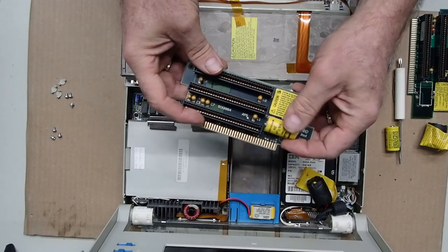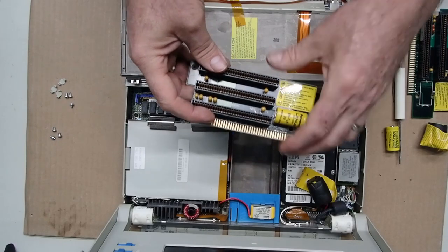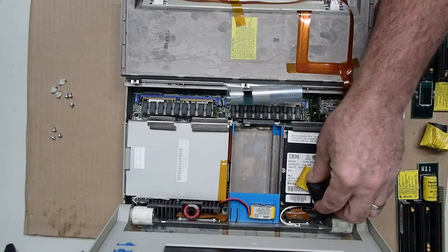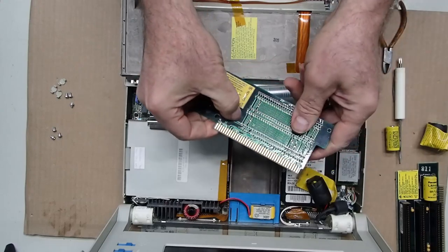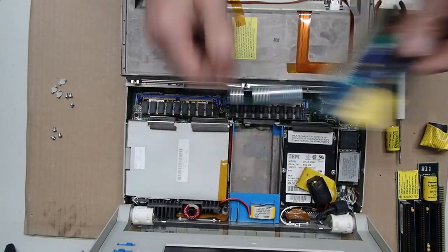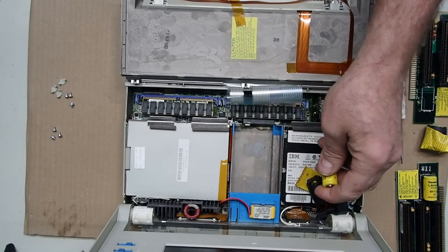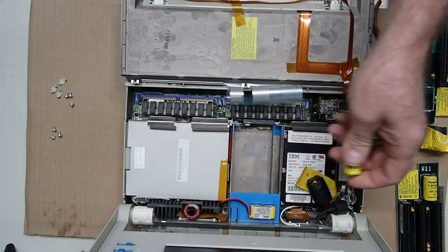If you don't buy a battery new now, you're using surplus from somewhere, you want to be involved in testing the battery, making sure it has voltage, as I did. And I'm sure mine is going to last very well in this case. I pulled it off of this riser. It has a single lead for the negative side, dual lead for the positive side, and you want to leave those battery tabs on there. You don't want to solder directly to the ends of the battery, and going through on the old harness you pull out, you want to clip off those leads so you have a place to solder on that you don't have to strip back those wires or anything like that.